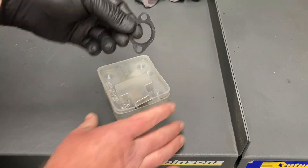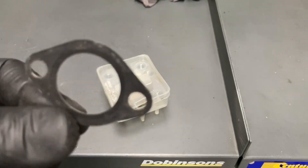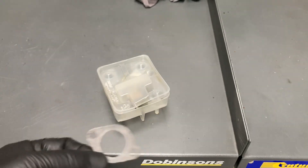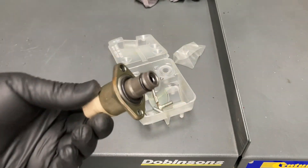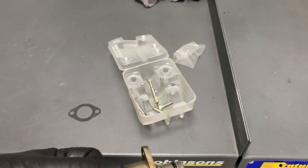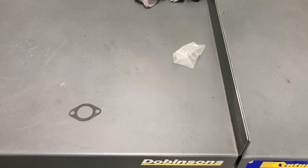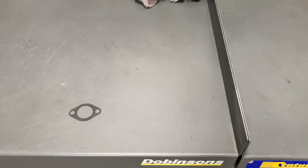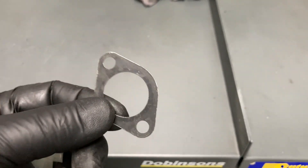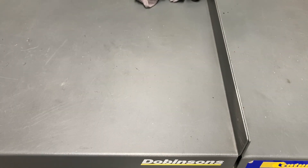Here we go, we've got a story here. The old suction control valve — there's a gasket here. The gasket usually should stay on the vehicle when you replace the suction control valve; it doesn't come with a gasket. Everybody knows by now, these short ones are rubbish. Your nuts and bolts and bits and pieces — don't lose those, because I haven't got any spares anymore. The gasket should stay there, but if you've got one of the later pumps with a long SCV already, I believe they don't have a gasket. Let me know in the comments if you find anything different.